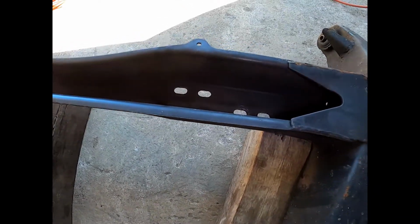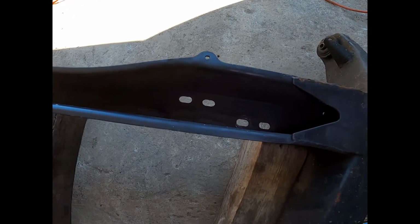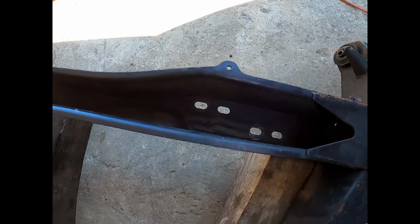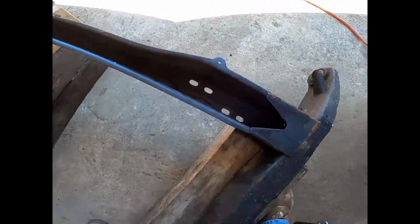The cradle then becomes way more stiff, and when you're dealing with a K-Series, which has a minimum of 50 horsepower over any engine that was offered in the Fiero, you can see where this is going to start cracking even quicker if you were to reuse these mounts.